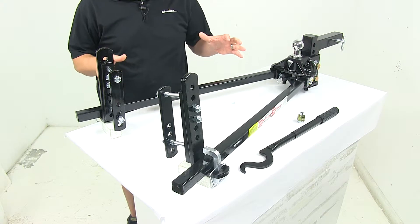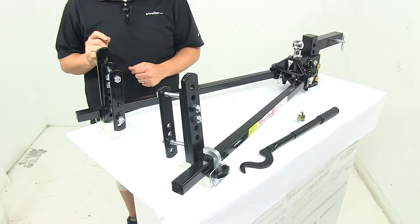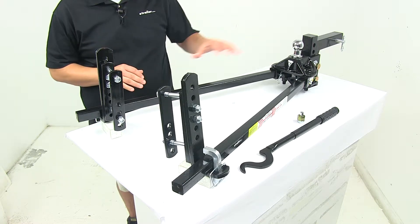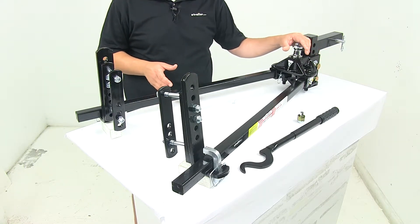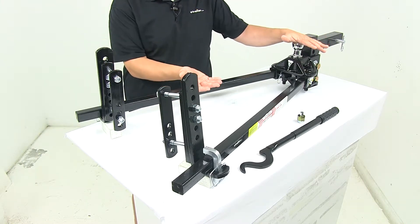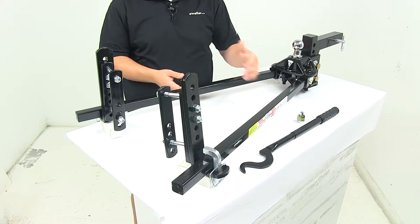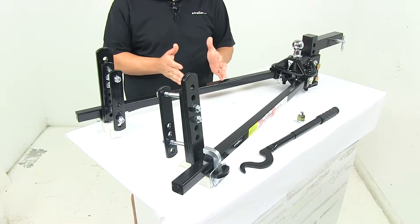This unit features integrated 4-Point Sway Control that's designed to work and stop trailer sway really before it ever begins or before it's felt by the driver or by those riding in the vehicle. The head right here creates two points of sway control using rotational friction. The downward pressure placed on the hitch ball fights or battles the upward pressure created by the spring bars, and the upward force on the spring bars on both sides of the system creates the rotational friction that forces your trailer to stay in line at all times.